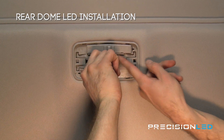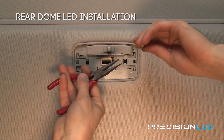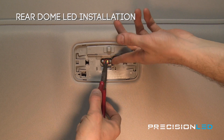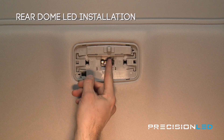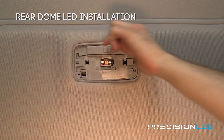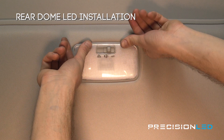Now we can remove the halogen bulb just by pressing down on this tab here — just be sure to catch the bulb. Here we have our 5730 style LED. Again these are non-polarity specific so you can just install in any orientation. We'll be using needle nose pliers so hands don't block the shot. First install on the stationary side, then apply a bit of pressure on the positive tab side until the LED clamps into place. Make sure the LED boards are facing downward, then test the bulb — everything looks good. Reinstall the lens by lining up the two back sides opposite of the switch, then apply a little pressure on the front until the front tabs clamp into place.